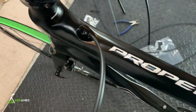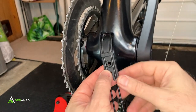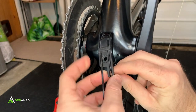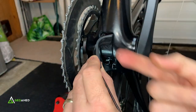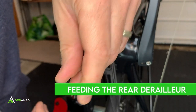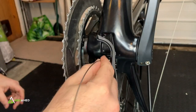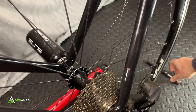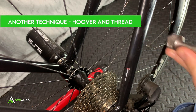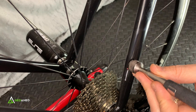With the camera repositioned for a better view, threading the other side: the correct configuration is the long cable on the short sheath side, and the short cable on the long sheath side. This is because the cable needs to twist on a steep angle to come back at the frame. Feed the cable first into the arm, then use the magnet to guide it down through the frame — you can hear it clearly.